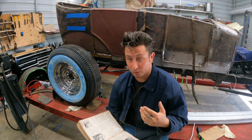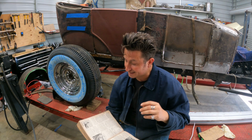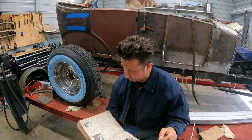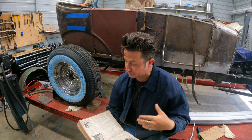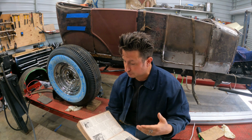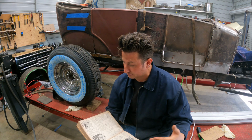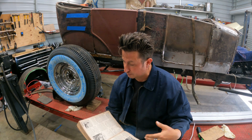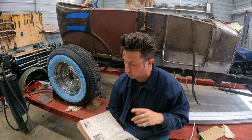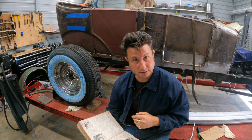A cylinder bore of less than 5 thousandths wear or taper may not entirely clean up when fitted to a high limit piston. If it is desired to entirely clean up the bore in these cases, it will be necessary to rebore for an oversized piston. If more than 5 thousandths taper or wear, then they should be bored and honed to the smallest oversize that will permit complete resurfacing of all cylinders.